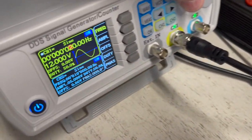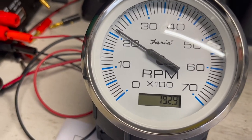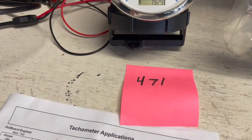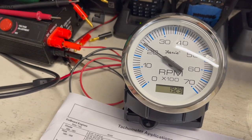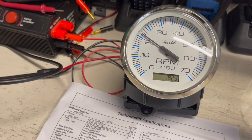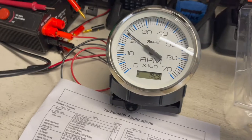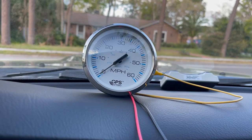Once we're above 500 RPM, the hourglass blinks and it's counting hours. I've already got 192 hours on there from running it for quite a few days. At 70 hertz that's a little over 2000 RPM. I've run this for many days and I'll let it run up to match what's on the motor. Last check showed the motor at 471 hours — I'll put the computer back on the motor's ECM to confirm the exact figure so my hours match precisely. The boat's current hour meter is about five hours less than what's actually on the motor, so I want to get it accurate.